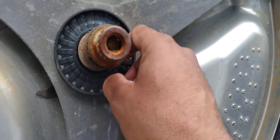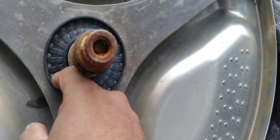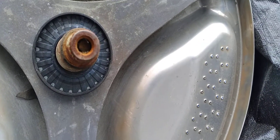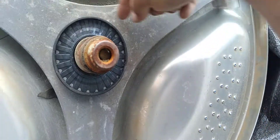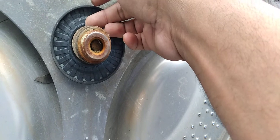It won't be waterproof. There is always a gap — mostly the gap has grease around it, but that won't keep the foam from reaching the bearings. The bearings are your moving parts that hold the drum arm, and the whole assembly is called the spider.